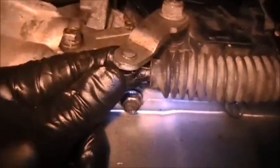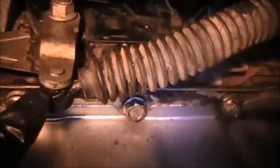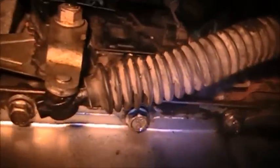This one is broken as you can see. What we're going to do is disconnect that cable from the linkage on the transmission. You can take a screwdriver and put it under there — like there. I'm trying to do it with one hand while holding the camera. I'm going to push it off — it's broken. It's a grommet on that cable; it fits right in that tab and in this bracket. There is supposed to be a clip there, but this one didn't have a clip.